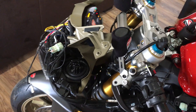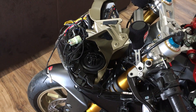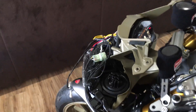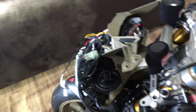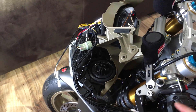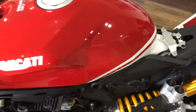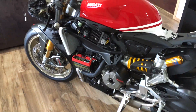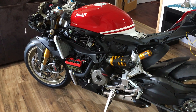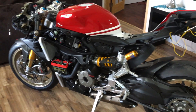So the bike has to be on, and you can see it doesn't do anything while the headlights aren't on. But once you turn the headlights on and then you turn the fan on — yeah, like I said it makes a huge difference on the heat of the bike when you're sitting in traffic. If you just leave it on, it keeps the bike around 190-ish. You can definitely tell the difference.